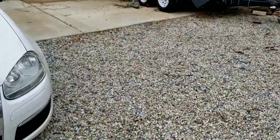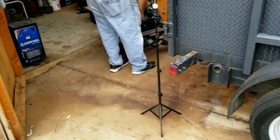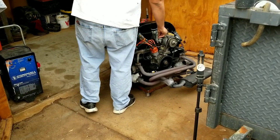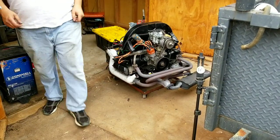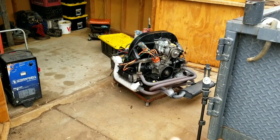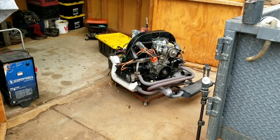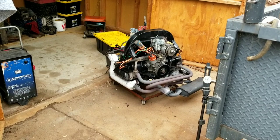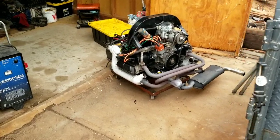And then maybe we'll put some other parts on it. I'm going to go to the swap meet maybe this weekend, hoping to get lucky and find some performance stuff, maybe some better heads. I could always put the 88 cylinder slip-ons on there and put some bigger heads on it, see how that runs. So that's the whole idea: you start out with a little bit bigger cam than what you really want for your engine, and then you can add to it. That's kind of my way of doing things, because I always over cam a little bit, and then I can always put more stuff in it. But I think this thing's actually going to run well just the way it sits. It really sounds pretty mean.